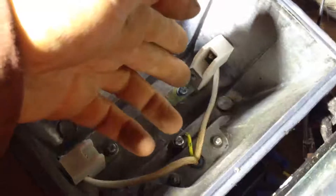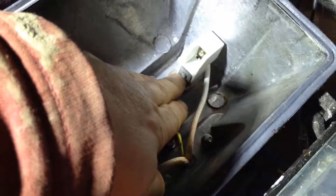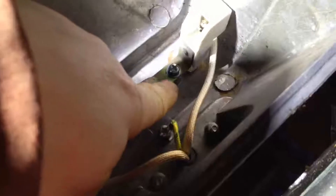So what I did was I removed the two nuts, you take out this whole little assembly here. You tap both of these with a hammer — they're only made of ceramics, so they should break off easy enough, or just cut the wires, but you need the cable anyway. So with these removed, I put it into a vise and just gently bent this little piece of metal — this little tab — just over at 90 degrees. So if you look at it carefully, you can see it goes across, it goes up, then it will be going across again, and where it bends across it will actually be higher than this point here.